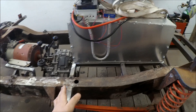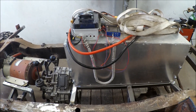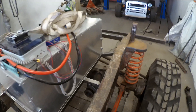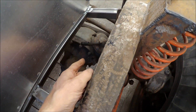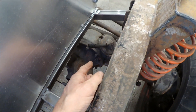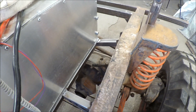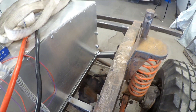I can't push it any further backwards — the torpedo wall is right there. You need foot space on one side, and on the other side there will be brake and gas pedals. I pushed it a bit to the side because the vacuum control for the differential lock was colliding before. That's why I could lower it 30 millimeters — now it's as tight as it can be.